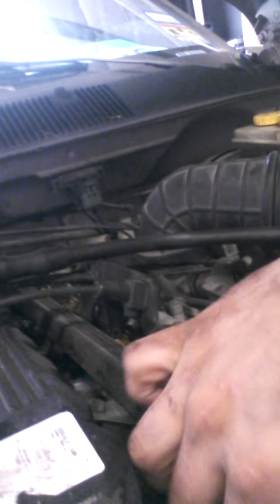So I'm going to do this. Remember, when I would touch that a while back, it would actually turn on. I'm going to move this wiring loom up here. Now I'm going to do the same thing and see if the light turns on. And let's see, nothing. I'm going to leave this light tester on there, and I'm going to put the wire back on here. Look at that. Not touching, and touching. There you go. So that is your issue.